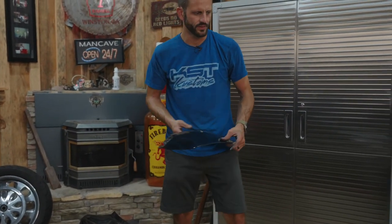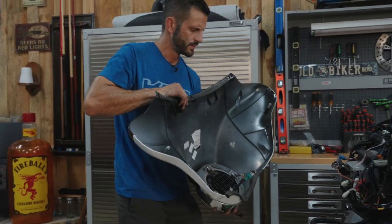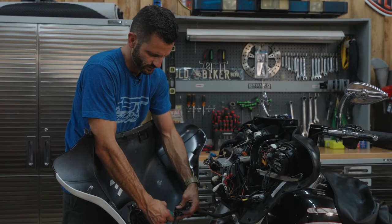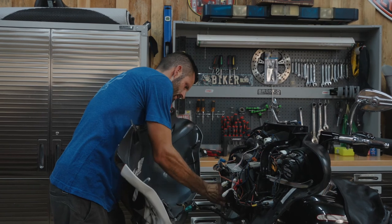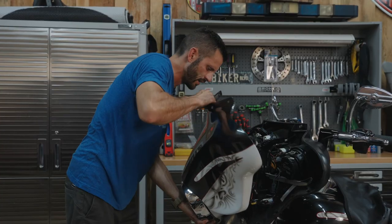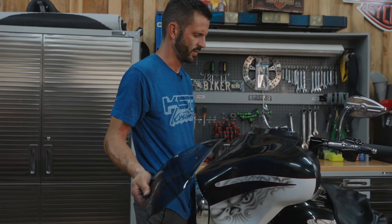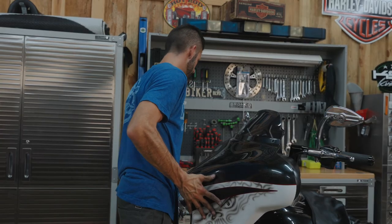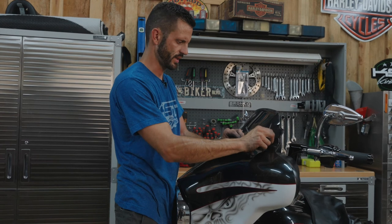Get our windshield — you can just sit it on the fender — and then get our outer fairing. We're going to plug up our headlight. Remember this is an aftermarket headlight, so yours may look a little different. The main thing to look for is your blinker wires — make sure they're tucked out of the way or zip tied — and your headlight harness out of the way. Torx 25 bolts, three of them on the windshield. Get the inner bolts on the inside — this is where you want to be able to turn the front end to access the bolt hidden in the shroud.